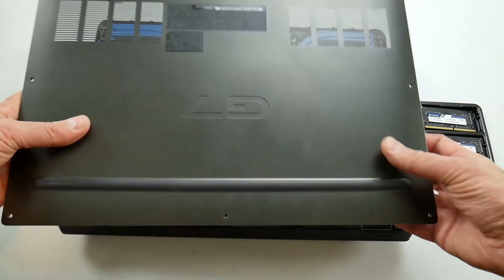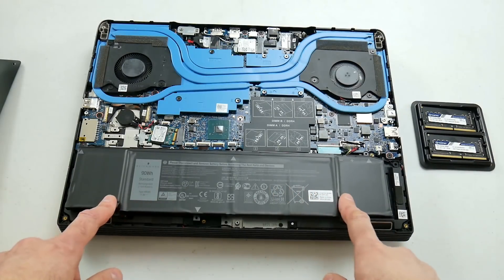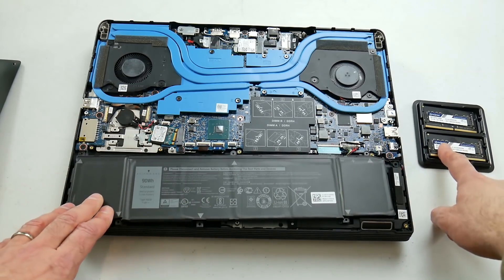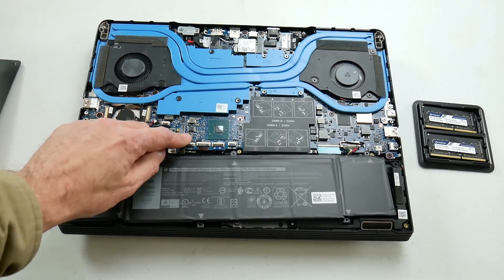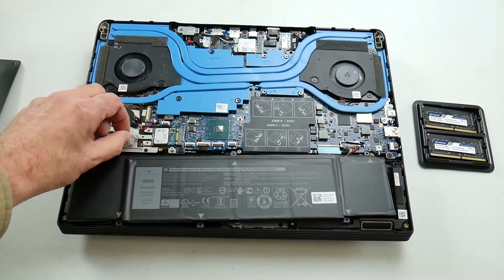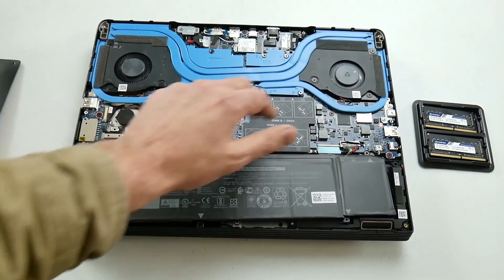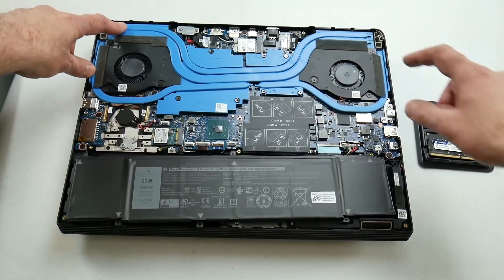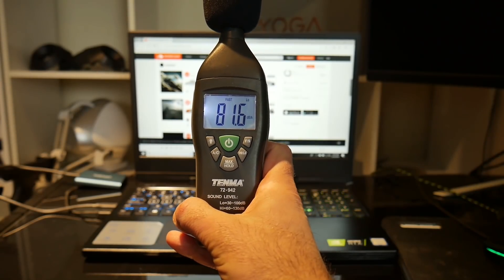Like the G5, you remove Phillips screws to remove the aluminium back cover, which is nice and solid. Here is the 90Wh battery — if you have the 60Wh one, the hard drive would be here. The SSD is half-size but there is a sliding mechanism for full-size cards. You have two separate heat pipes with two shared ones leading to four heatsinks, and the speakers fire downward at the front — they're actually pretty good, not tinny at all, and quite loud at 82 decibels.